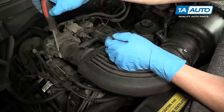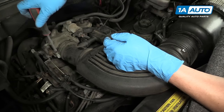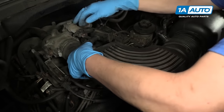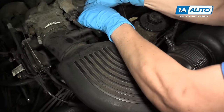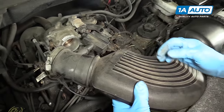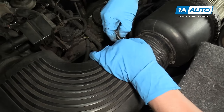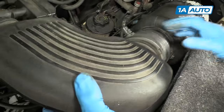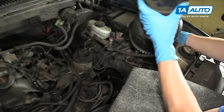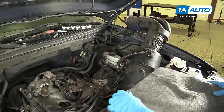You can take your flat tip screwdriver and put it right on this hose clamp to unscrew it. Once it's loose, you should be able to pop it right off of the throttle body, and then you can pull this whole assembly right off — it just pops right off with some pulling force. Right here you have your intake air temperature sensor that you'll have to disconnect. Then you should be able to just lift this up and move it out of the way.